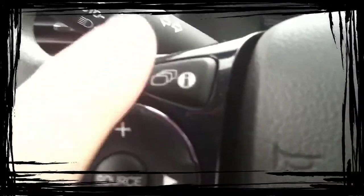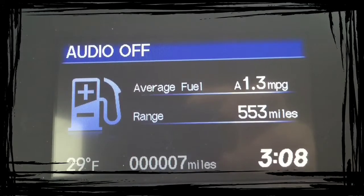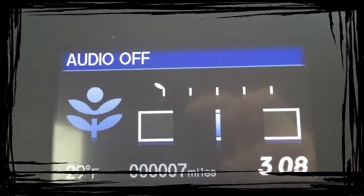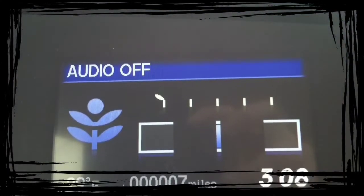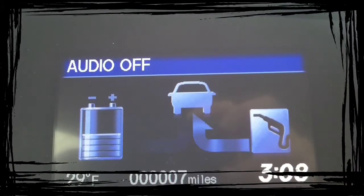Right here you have this button which controls the screens. On a regular Civic you only have four screens; on this one you have more. There's your audio for turning your radio on and off. There's your range to empty. You'll notice when you drive a hybrid, the bars will go left and right to tell you what kind of fuel economy, how efficient you're driving, whether it's charging the battery or assisting. You'll get little leafs, then little buds, then a flower, and once you get five of those you'll eventually get a trophy — although I've never seen one in my car. This just tells you whether you're using the gas motor or the battery, and whether it's assisting or charging depending on how hard you're accelerating. And there's your clock, and we're back to your radio.